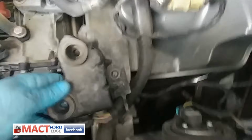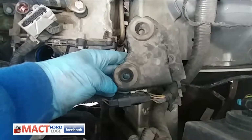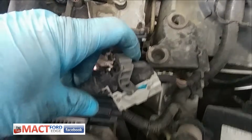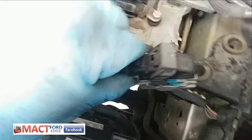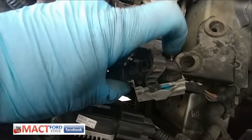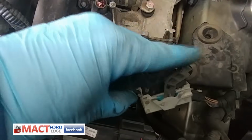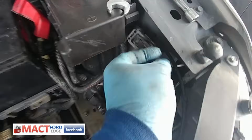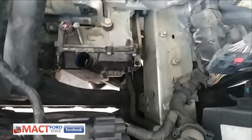I took this piece off that holds the air filter in. I took that out of the way, and also took the connection to the transmission main cover. I wasn't sure exactly how to get it off, but coming in from the right hand side, the driver's side, and going under this with a little stubby flathead pushes this piece down, and then that pops over real nice, goes right over the stubby, and then you can pull it off real easy. Get that all out of the way, and it pretty much opens up everything right there.